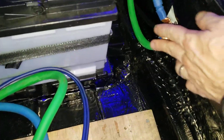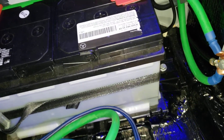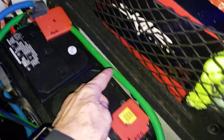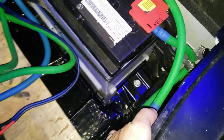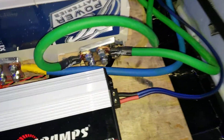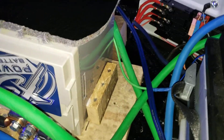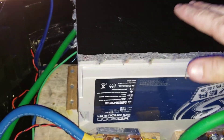This is the factory ground in my car right here. I got a factory ground going right to the battery — beefed up my factory ground, which probably helps a lot. Then I got a ground wire wrapped all the way around that goes to the second battery. I need to shorten these wires a little bit because this wire could just go from here to there, but I didn't want to cut wires and start adding more lugs and heat shrink. The battery doesn't move — I got wood on the sides of it and the speaker box sits on top.